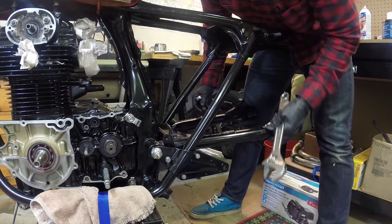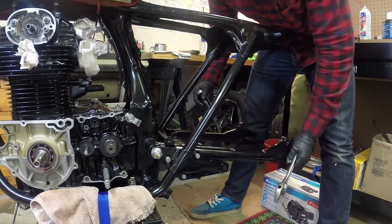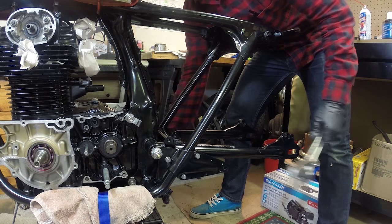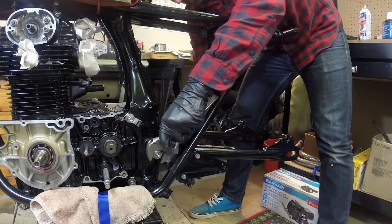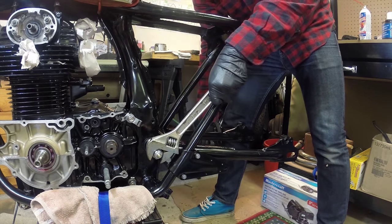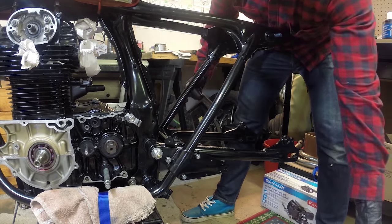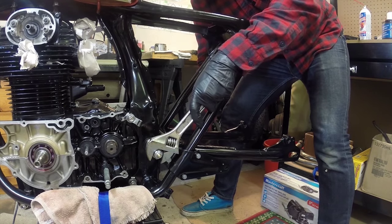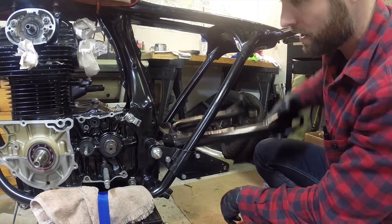Now that my brackets are firmly in place on both sides, I'll be able to torque this bolt much easier. The swing arm is still moving — that's good. Dust seals are all good, seals are all in place. I have the torque wrench set to 40 foot-pounds on the other side; I'm going to hold my adjustable wrench here and give it opposite force, slowly working up to the torque. That's 40. I'll bring it up to 45 foot-pounds. There you go — 45 foot-pounds. Swing arm is in there. Still moves, doesn't make any weird noises.